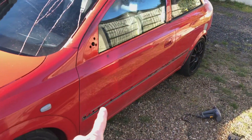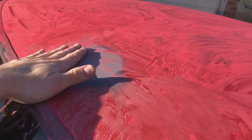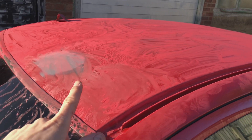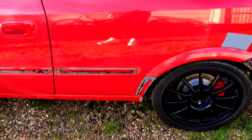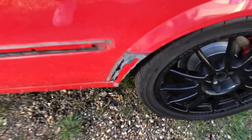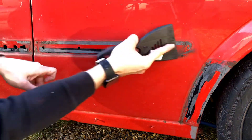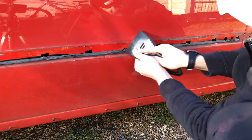You can see here I've stripped everything down — side skirts are off, the side strips are off, spats are off, and that window comes out now with just two bolts holding it in. I've already started sanding down the roof, filled in a little dent, primered that over, and it's perfectly smooth. I flatted down the whole roof with 400 then 600 grit. One of the problems now is that the side strips and spats were glued on with a polyurethane adhesive, which is a really tough adhesive to remove — petrol and all sorts of solvents don't touch it. I'm using a heat gun to get rid of as much of that polyurethane adhesive as possible, and then I'm going to use a really sharp Stanley blade to cut it down as close as I can to the paint without damaging the existing paint underneath.